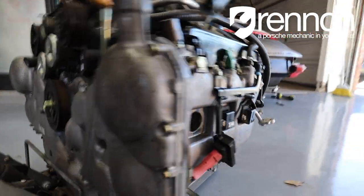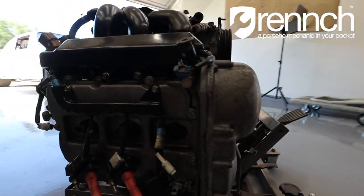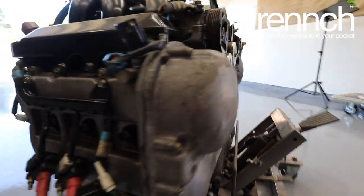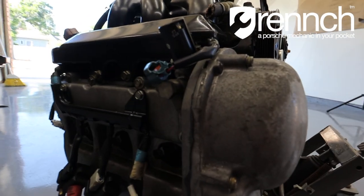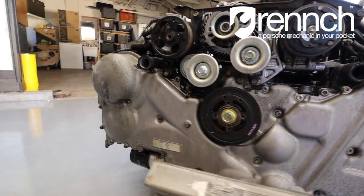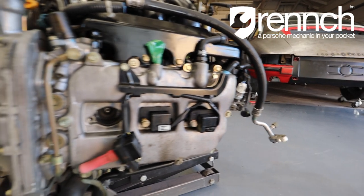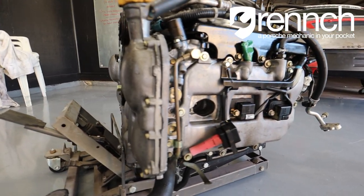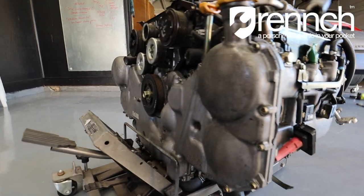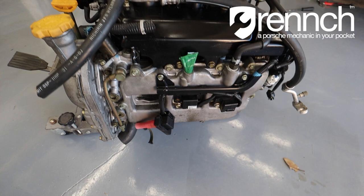Let's go meet it — years and years newer. We now resume our regularly scheduled engine breakdown. This is the Subaru EZ30, otherwise known as the EZ30R by enthusiasts. It's the second-generation EZ30 — a water-cooled flat-six engine featured in the 2004 to 2009 Subaru Outback, Legacy, and Liberty. Compared to the first-generation EZ30, the EZ30R was revised to add the Subaru Active Valve Lift System to the intake cam, providing both variable valve timing and lift for the intake valves, resulting in increased power, torque, and economy. It's essentially Subaru's answer to Honda's i-VTEC.